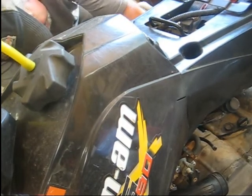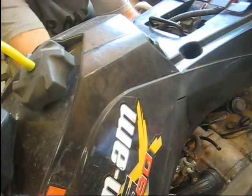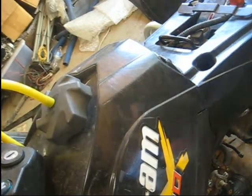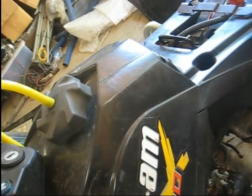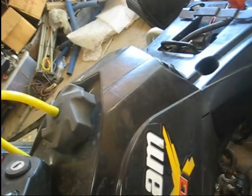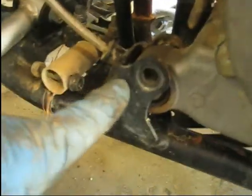Okay, it's almost in there. Rear a little bit. Let's see what we're hitting on. We're hitting on this rear motor mount on the frame. It needs to be picked up a little bit to get over that. And then that's pretty much it. Let's see, we got our front mount in there. The back one is almost in. It's got to go down. Actually, when I just touched it, it fell down. So that's in there. The front one over here is in. It's just low. And the bottom down here is very, very close. So pretty much it. Just sat it in there.